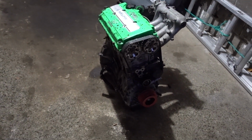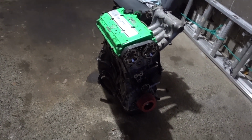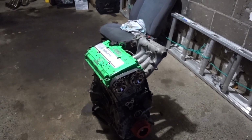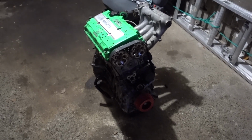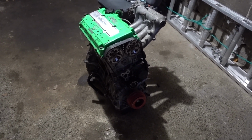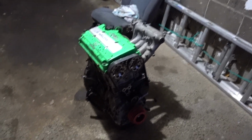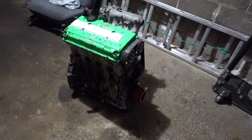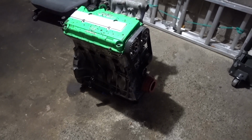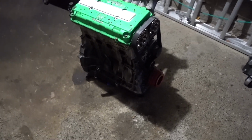Like I told you, it was a B16 turbo, but actually we blew that one up. The piston blew into pieces. Two injectors clogged up and leaned down cylinders 1 and 2. Cylinder 2 was the one that got the worst. It disintegrated the piston, and a rod came out the block. So in about a week, we actually did a B20. We literally were trying to find anything so we could go to the track again.